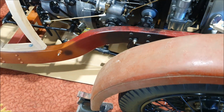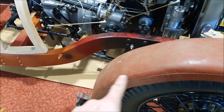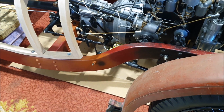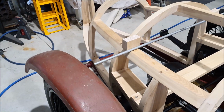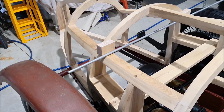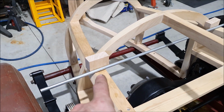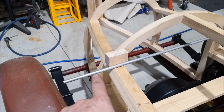And then the rear mount depends on what style of guard you've got. If you've got these cycle or these short type ones, or if you've got the long, more road version of the car, the more touring version of the car, in which case there's another mount at the back somewhere. And the rear ones, because my body isn't a copy of an original and there are no blueprints, it's a little bit different. So I need to make what works for me. But as it happens, I can put the top mount on top of this rail, and that puts it in a nice position. So you really want these to be as straight as possible.